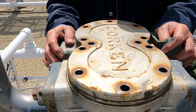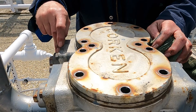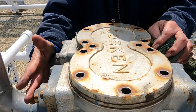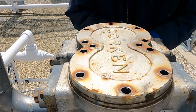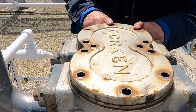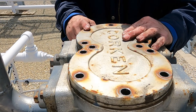And they're expensive. By the time you pay for the valve, your two O-rings, your crush gasket — provided the lock nut doesn't get damaged and your cage stays good — you're close to nine hundred dollars a valve, maybe a little more. If I can go two solid years, maybe three years, before I have to change valves out, that's money ahead. I want to keep these machines as high efficiency as possible in a way that doesn't bankrupt me and eat up my profits. There's no gasket — it's just metal to metal — so that's why condensate or discoloration inside here isn't that big of a deal.